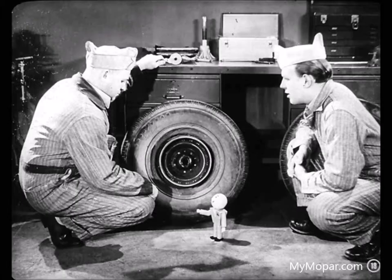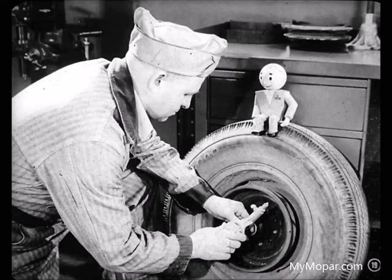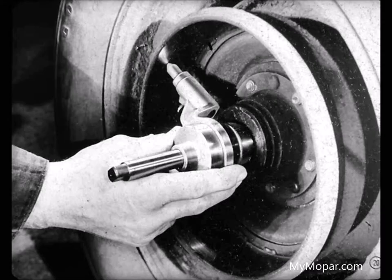That's good. Now, how about checking the drums for out of round? You always do that, Larry? I usually do, Joe. I don't know as it has much to do with noise, but it sure helps me to get a good shoe adjustment. Now, according to this drum gauge, these drums are round within .005, so they're okay. That means we're ready to check the shoe adjustment.